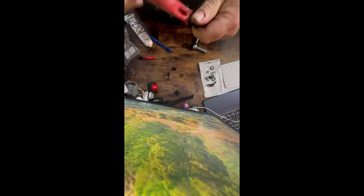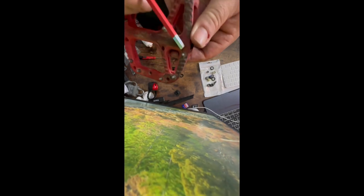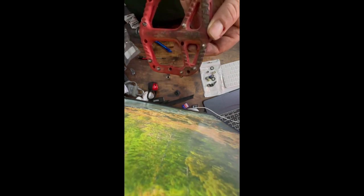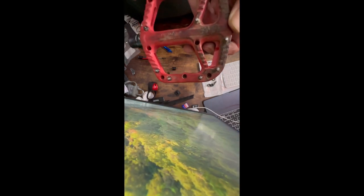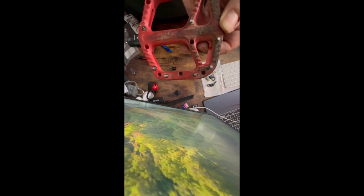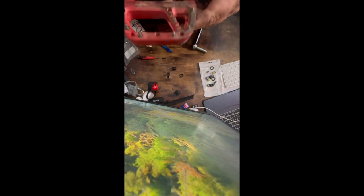Feel the movement — perfect, not too tight, not too loose, and it's got some new grease in there, so it's ready to ride for another year. Now, one thing I like to point out: some of these pins on mine started to get a little worn out. I could order pins and replace them, but some of these inner ones my foot doesn't use that much, so I might just swap some pins around for the season to be a bit cheaper. Maybe by next season I'll need to replace the pedals or just service them again. Thanks for watching — that's how you replace the bearing in your one-up pedals. Please like and subscribe.